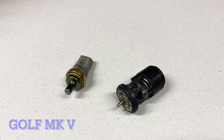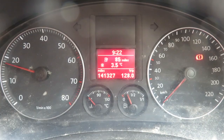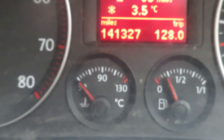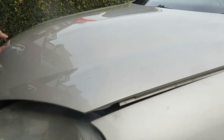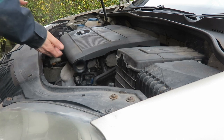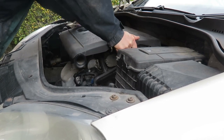I'm going to replace the heat sensor and the thermostat in my Mark V Golf. I drove the car about 20 miles and as you can see the heat gauge still isn't registering. I'd imagine the problem is the actual thermostat given that it's such a cold day outside, and I don't need a heat sensor to tell me that the heater in the car isn't working great. But considering I'm going to open the system at all, I'm going to replace both parts to save me coming back and doing one of them again. They're not very expensive parts anyway.